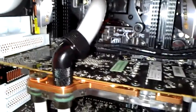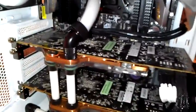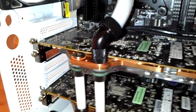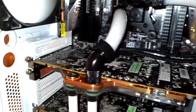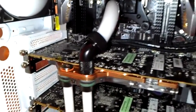Because as you know, if you just run straight water into tubing, it will start to plasticize, which means it makes the tubing start to look cloudy. With this product, it kind of alleviates that plasticizing, like it delays the process of the water sticking to the tubing and coating the tubing. So therefore, my tube will last longer than usual. So there's a bunch of benefit with this, and it does transfer heat very well. So I'm happy for that.